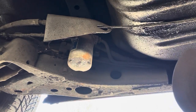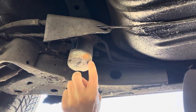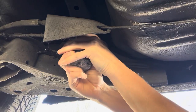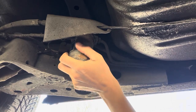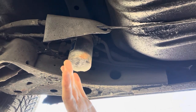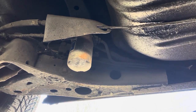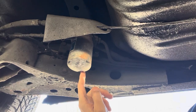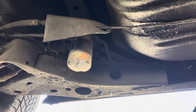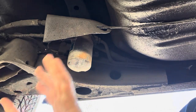I felt something move. I do have a three-fingered wrench, so there's three notches here. I think I have one. Oh, there we go. Okay, I see fuel. So there might be a little bit of pressure in there still. It is a TBI, so it's only a low pressure system, but it's pretty safe to say that there's gonna be fuel coming out. So I might put a rag or a container down, but it looks like she's gonna come. That's good, with no tools, just my hands.